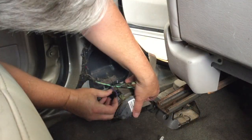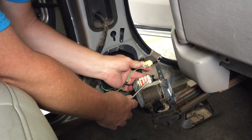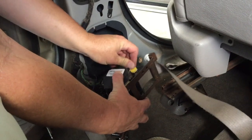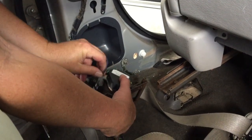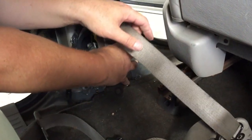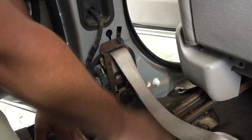You'll have to remove two clips. This one has a little clip over here — you can just use your finger or get your screwdriver right in here and it'll pop right out just like that. We have our new motor so we're just going to plug our connector back in here, just like that. Put this back in here — it'll click, make a clicky noise, like that. And now we'll mount it back in here and get our screw and tighten it up.